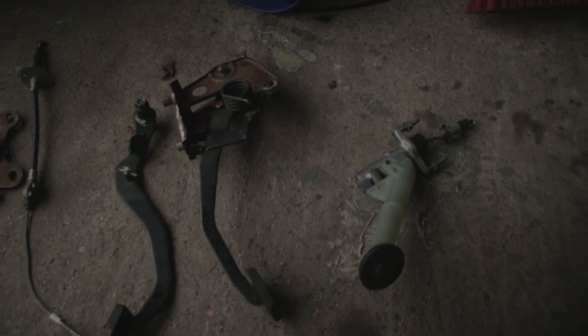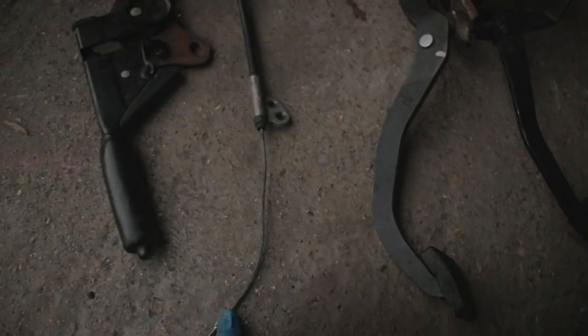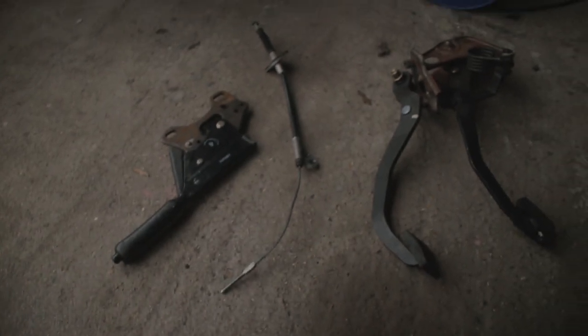Obviously the pedals are what we're after. The Toyota Crown JZS171 never came as a manual, so we are able to use parts from the JZX110 as well as the Lexus chassis. Today we're going to be looking at the pedals, because it is the biggest hurdle — we've got a foot e-brake, or a knee brake, so we need to relocate that and get a normal handbrake. There are some JZS171s converted to manual but it's still quite unknown, especially in the UK. I've got a Lexus IS200 clutch master, IS200 clutch pedal, IS200 brake pedal, IS200 handbrake cable, and a Mark III Supra handbrake lever.